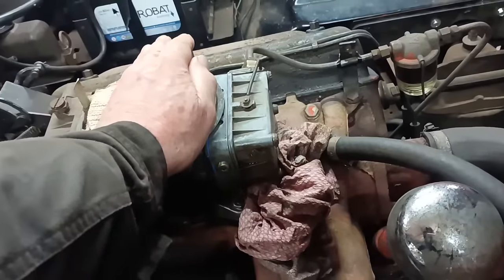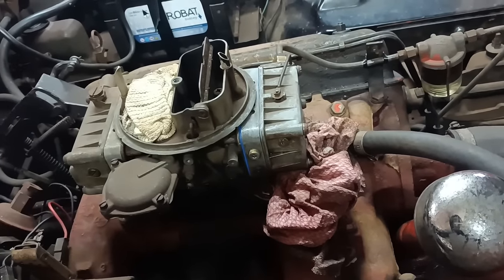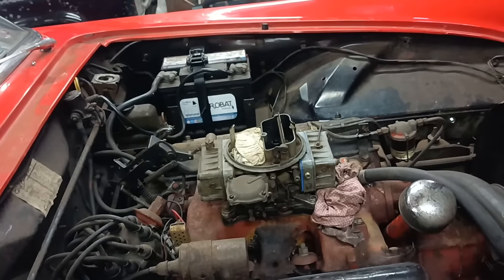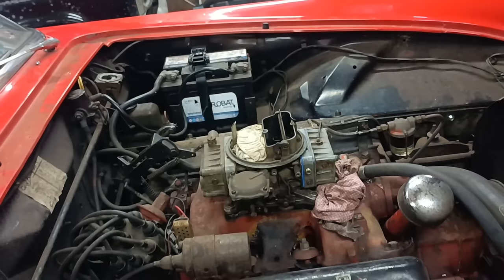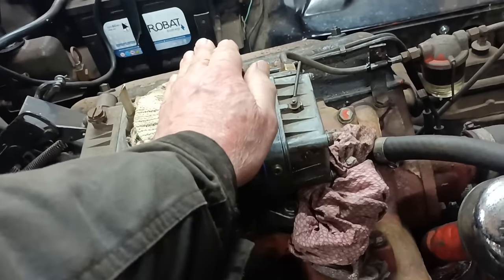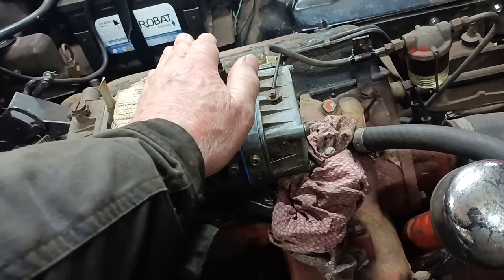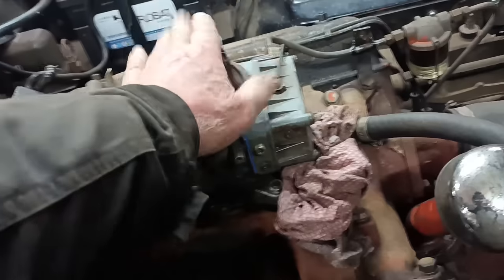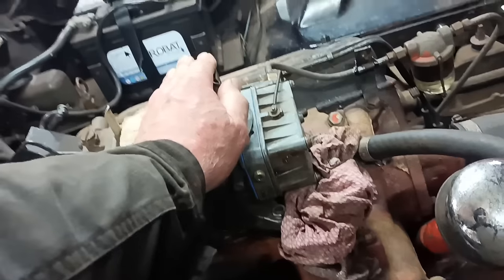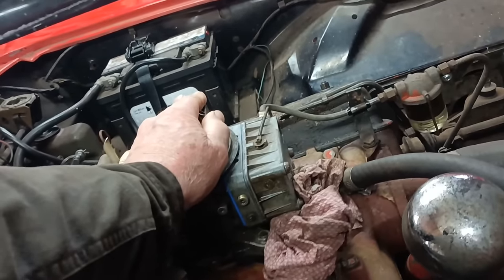Explain this to me. It's running, it's quite cold. If I take that off, oh, it's not too bad now. If I choke it, it picks up again. That means it's not drawing fuel through correctly, doesn't it? It's having to create more vacuum to suck it through.